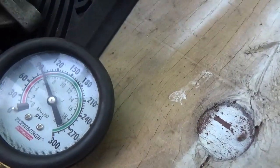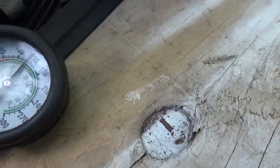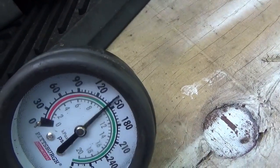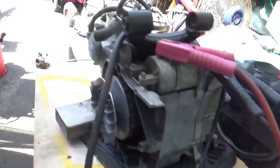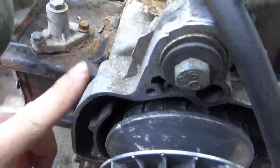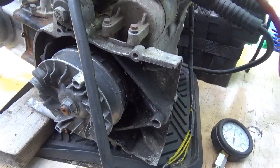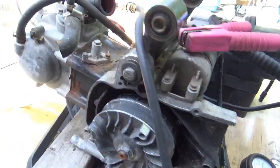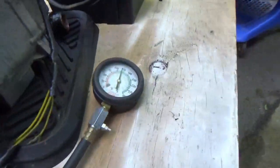It's reading 140-145 PSI — that's not bad! By the looks of the coloration, the exhaust system and everything else, I don't think there are many miles on it. This is also a long-stroker, and it seems that the longer the stroke and the faster it turns over, the higher the compression. So coming in at nearly 150 makes sense.